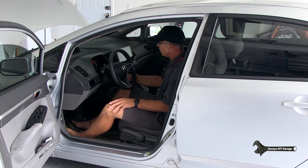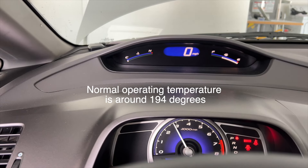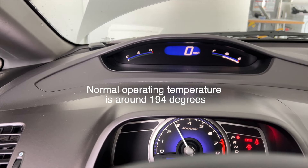There's two seconds — one, two — start it. Now we're going to bring the idle to 3000 RPMs. Right at 3000 right now, and I'm just going to hold it until those fans get up to cycle on and off. That will indicate that it's in operating temperature.